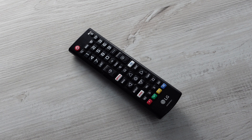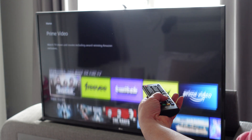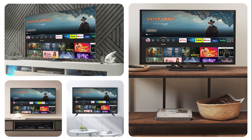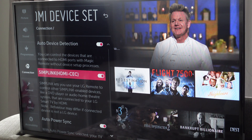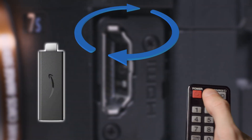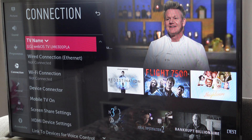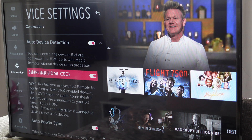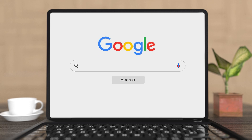The next step is something that most people don't think about trying but is the most simple solution. Pick up your TV remote while your Firestick is turned on and check if your TV remote works with your Firestick. Newer LG TVs, for example, will be able to do this, along with other models of newer smart TVs. This works by utilising the HDMI CEC function and allows devices connected to your TV's HDMI ports to communicate with the TV remote. The HDMI CEC option is usually already turned on as a default, but you can go into your TV's menu, options or settings to manually check and turn this feature on. Some TVs may have called this function something other than HDMI CEC, such as Simplink, NetCommand or EasyLink. If you can't find this option, do a web search for the model of your TV and how to enable HDMI CEC.